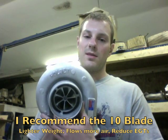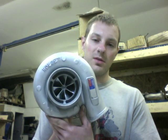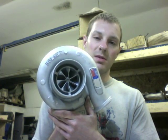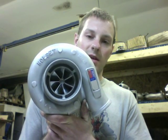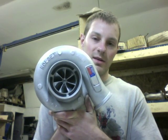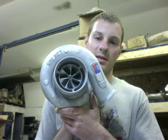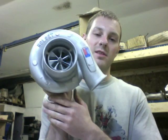Those are some great options you may never have thought about, since not a lot of people are upgrading these. Keep in mind this turbo is very unreliable unless you have the upgraded rebuild kit, because the factory thrust bearing is really weak. The upgraded rebuild kit uses an HX35/HX40 thrust bearing design, which is really the most reliable thrust bearing of any factory turbo and never even needed an upgrade. I'll go ahead and link to all the parts I just mentioned, including the upgraded rebuild kit, so you can see the difference between the factory kit and the upgrade kit.